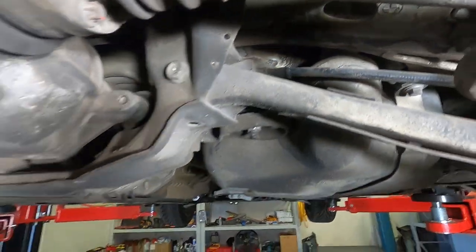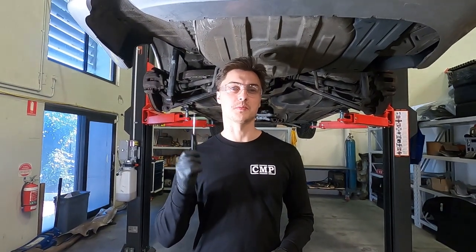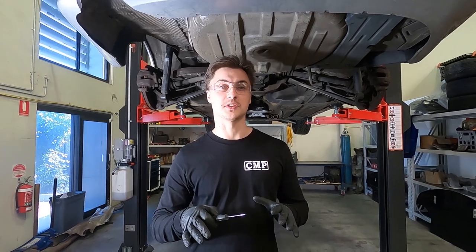So if you look closely, you can generally see where the bushing has left a rubberized mark, like a black mark in the carry panel itself, and that's an indication of the subframe bushing ramming into the chassis. This area is generally just a product of failure of that bushing ramming into the chassis, as those lobes poking out of the bushing actually have steel inserts in them. Now that we've had a look at where the subframe cracks, we're going to go ahead and finish disassembling this car.